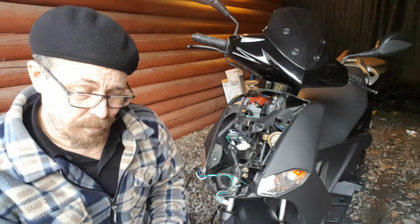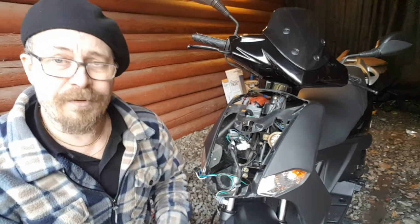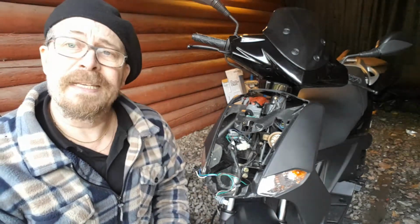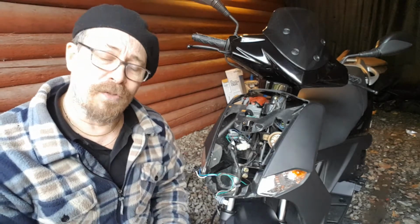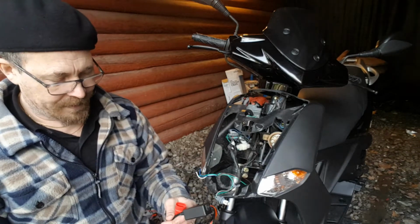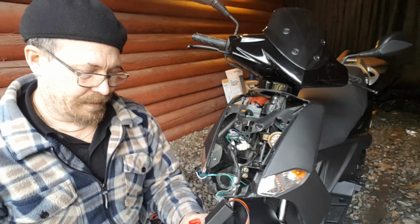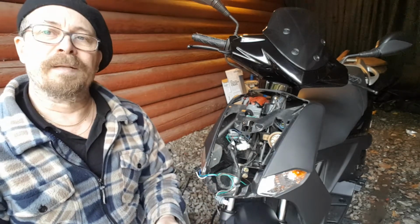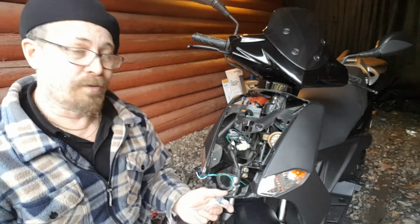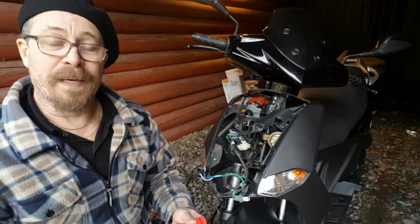And it's a 35 watt rated, input 12 volt, input current 3.5 amps, it would be like 3, I guess, and the peak would be 6.5. So don't have too thin wires, it's just when you start, but it's good to not have underrated wires, so the power will stay in the wires. Never have too small gauge on the wires.